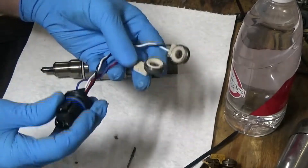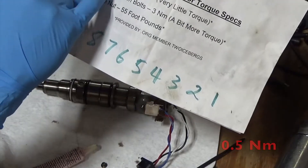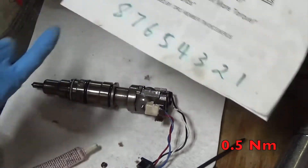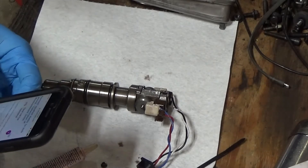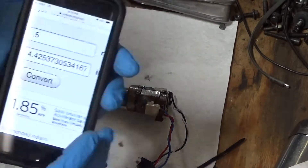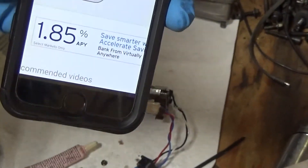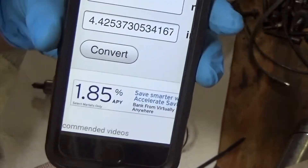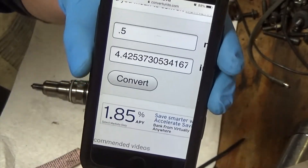From Bitterroot, I ordered a new connector and coil. With shipping it was around $70 to $80 — pricing will vary depending on where you ship from. You get two new coils and a connector. We're going to put that on today. The new coil solenoid bolt torque spec is half a newton meter, which converts to 4.4 inch-pounds.